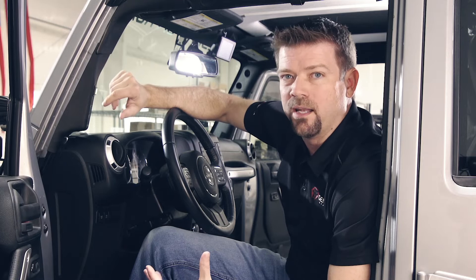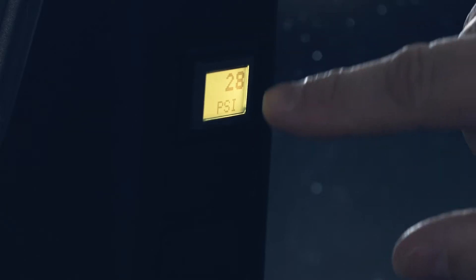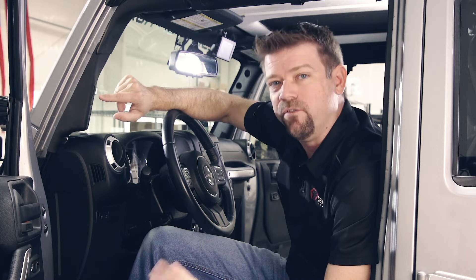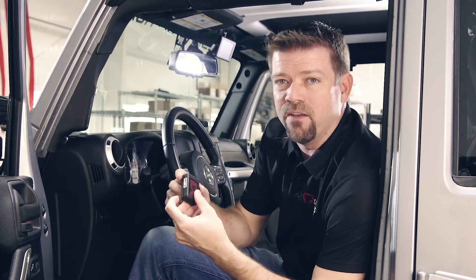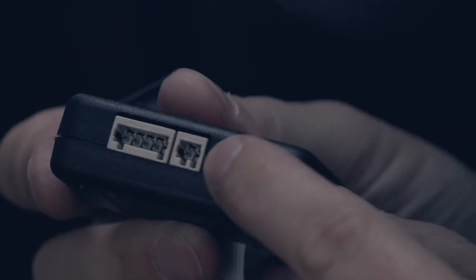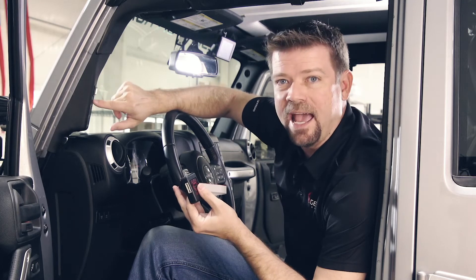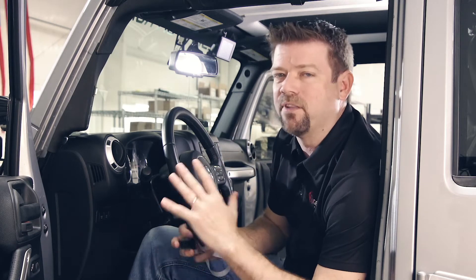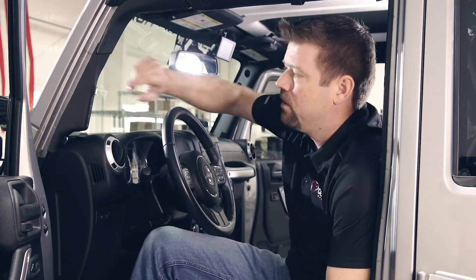We have a little sensor that can be screwed into your air pressure tank to monitor your onboard air pressure — this is for something like an ARB or Via Air compressor, not for your tire pressure. Right now my air compressor is off, but there's a little bit of air left in my tank. If you don't have the optional air pressure sensor plugged in, you're not going to see that screen at all. If you want to run the optional air pressure sensor, it comes with another cable that plugs into the second port on the interface module. As soon as you plug that in, the G-Screen will detect it and immediately add the PSI screen the next time you cycle through. Everything's plug and play, modular, and made to be very easy to install — no air hoses to run, no wiring to figure out.